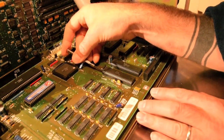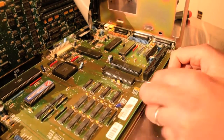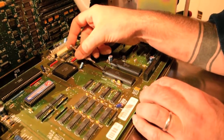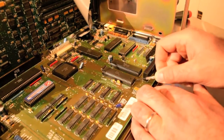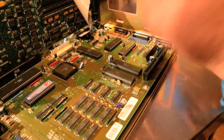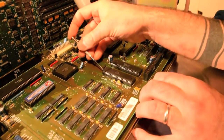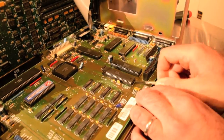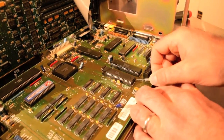I'm very carefully lifting each side with a very small screwdriver, just less than a millimeter at a time. I don't want to break any pins, because that could be a disaster. It's quite ominous hearing the keyboard creaking as I try and lift this chip off. I also have my anti-static device attached to the outer metal shell of the computer — I don't want to inadvertently fry any chips. This one's well stuck.